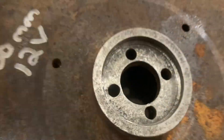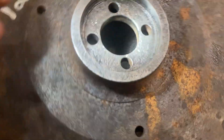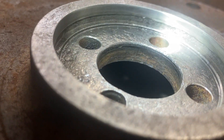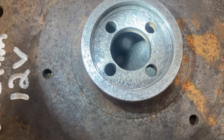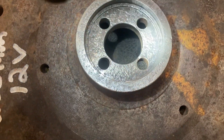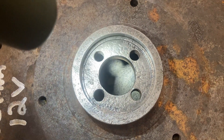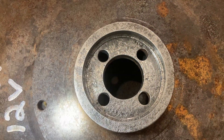What we have now is I opened up this bore to match the counterbore here. So this now has clearance to go over the 40 horse crank. I'm still going to do a little bit of deburring in there - you can just see there are a couple of sharp edges. And then I want to show you something about the 40 horse style, 6-volt style shims for setting your end play, and the difference between the older style flywheel and the 1600 ones.